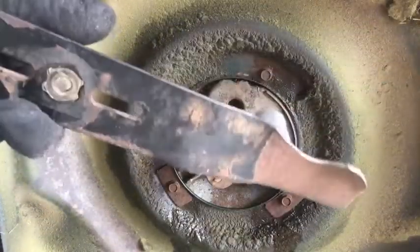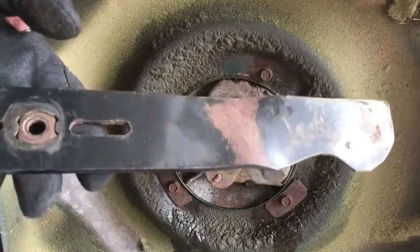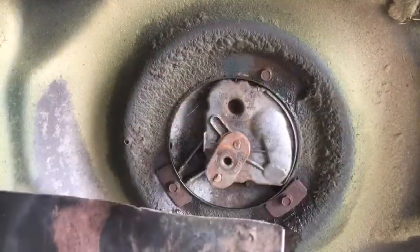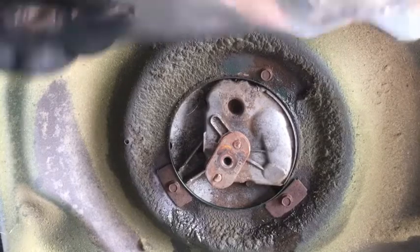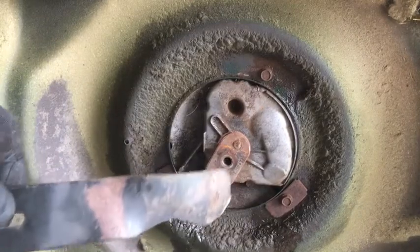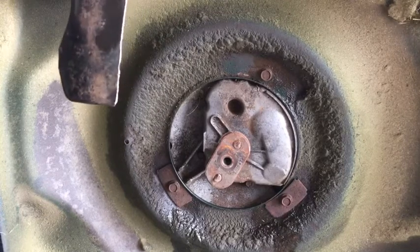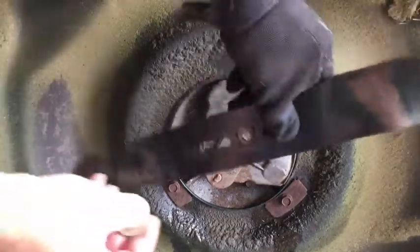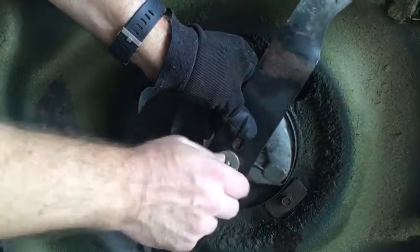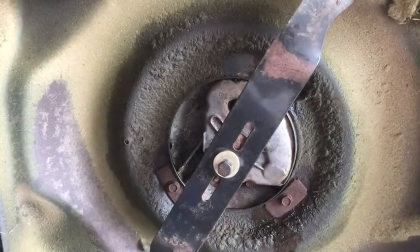It's got a specialized washer. This is what was on it. I know this blade isn't exactly great — it may not be perfectly balanced, but let's see how it is. This is a 20-inch deck and this is a 20-inch blade. It may be the only blade I have that would fit, actually, because the other 20-inch blade is for an MTD only. Make sure you get the right side — this side says 'grass.' It goes like this, do that, and then you just bolt it down.